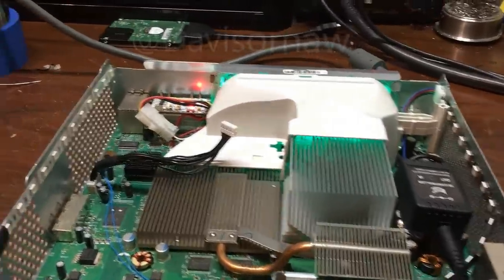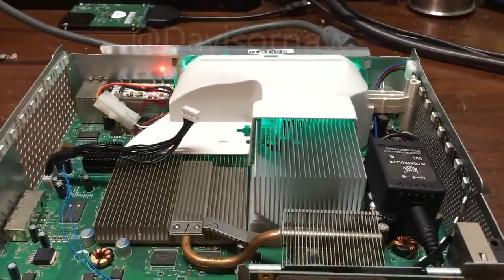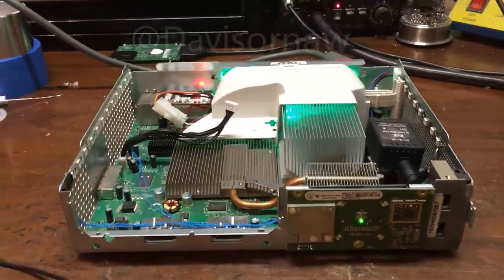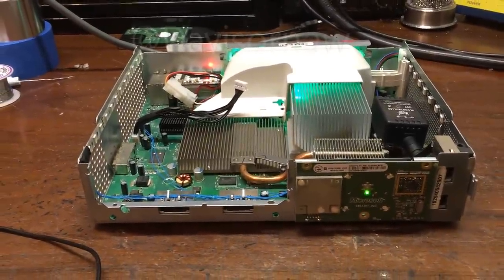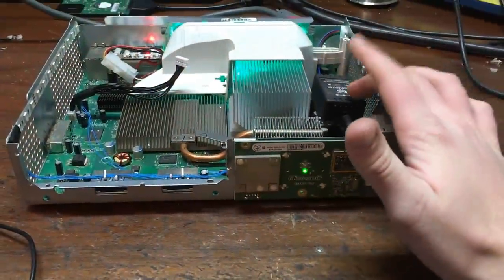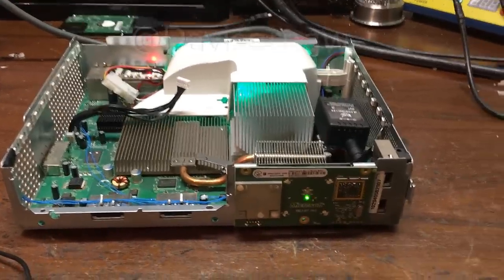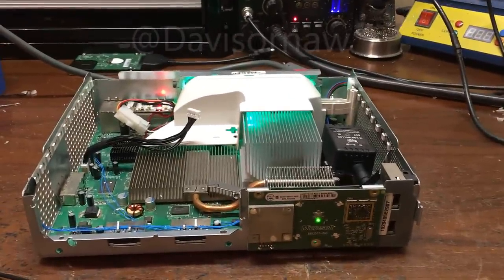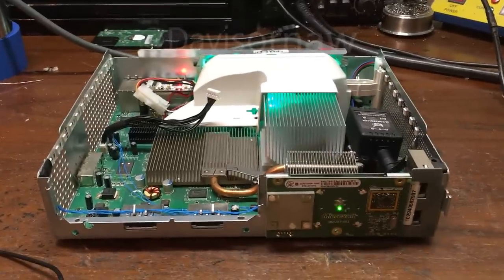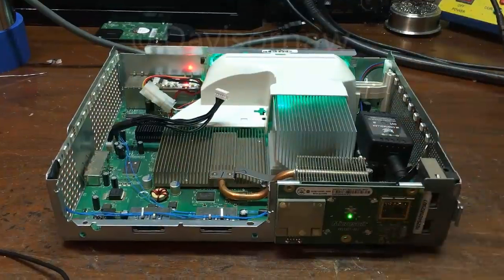Something I've also noticed with these music boxes is that if the fan is at 12 volts or 100% in Dash Launch — by changing it to 100% — it doesn't actually work well. It'll just blink randomly because the fans will be so loud. I think around 65% or somewhere around there is a good fan speed and doesn't mess up the music box.